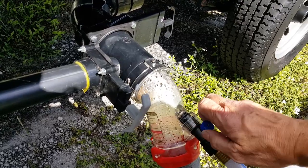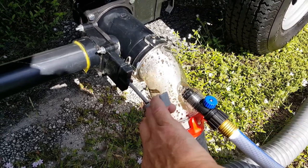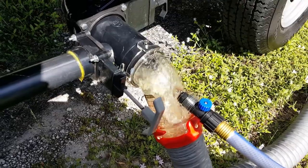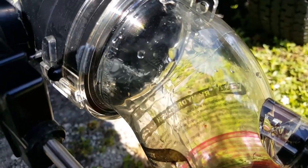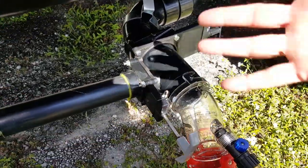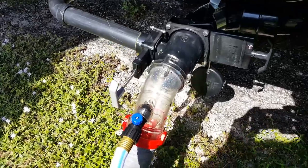We want to close this valve for the hose so nothing splashes up in there. This one is the fuller of the tanks and the water is gray — that's why they call it gray water. See, now that's helping to wash down the hose. We have just about all of it drained out. Now we're going to do the same thing — turn on the hose so the water jets up into there and washes out all the extra stuff that might be in the gray tank.